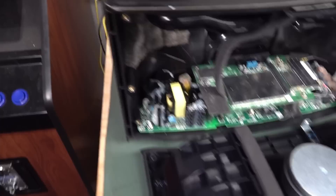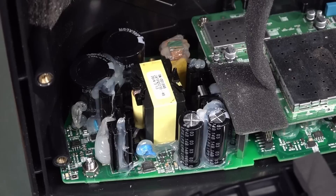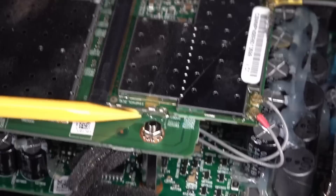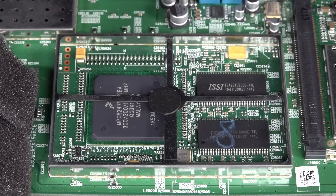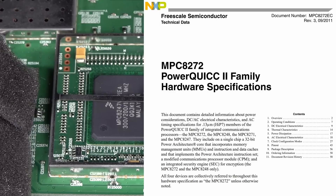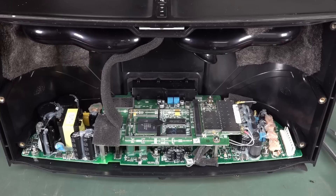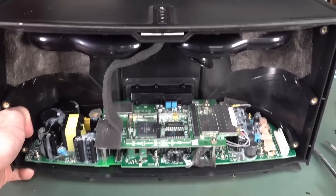Hands up if you know who actually designed this, because they've taken a serious amount of effort to get the acoustics the way they want them. I can't get that board out because the clip seems to be glued down in there. The processor was under here — that's a Freescale jobby. We've got the memory and flash under there as well. So that other board over there must just be the Wi-Fi interface board. It's fairly large by modern standards. I'm really impressed by this — the sheer amount of engineering. I didn't expect this level of engineering to go into this sort of thing.